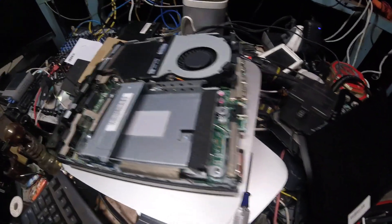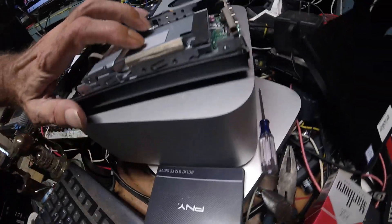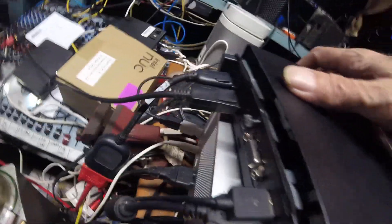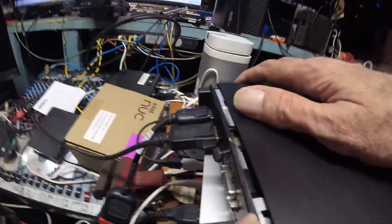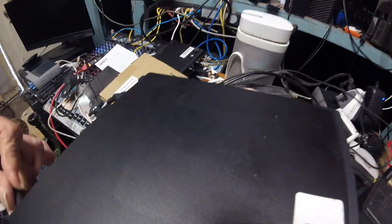I don't know why, but a magnetized screwdriver tends to clear the CMOS. Okay, so we now have that tray available for something else. But you see that it doesn't quite clear - it's sitting right on top of the NVMe. However, we're going to try it anyway, and we know that the bootloader on this drive will not load because this drive was just in a Dell T7910 and it has a bootloader for that one. Now let's reapply power. We'll at least let it attempt it - this one has Windows 11.